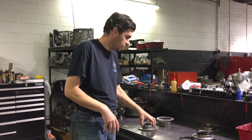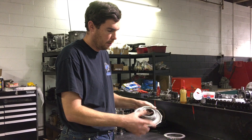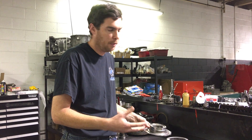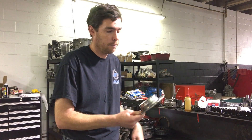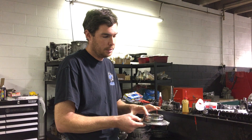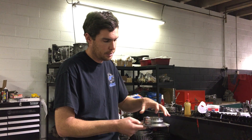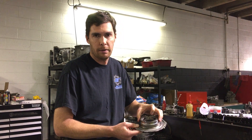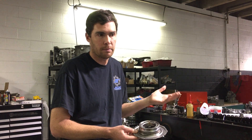The seal that we designed was pretty ingenious in that it uses a steel sleeve which actually presses over the factory piston housing assembly. That way you don't have to buy the whole billet piston assembly, which saves a lot of money. In the past it used to cost $1,200 to $1,500 for just one piston because the whole thing would be billet to fit the aftermarket seal. This technology uses a sleeve that we press onto the factory piston assembly, tack welded in place, and the seal we use is industry standard for transmission oil seals — a carbon impregnated PTFE seal which you'd find in many standard automatic transmissions.